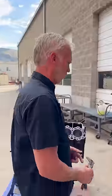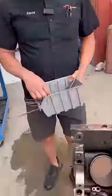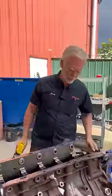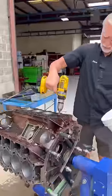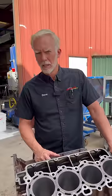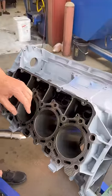This is what we do to get rid of all our beads. Every block has a passageway of capillary and artery for oil. You've got to brush and hone out every one of those passageways, and you'll have a box of different size brushes for different size holes to clean those out. Then you'll do the same thing with your cylinder walls. Every bolt hole needs to be inspected. Then we'll dry it, paint it, and move it into our build room. We'll show you that — we will blow every hole.